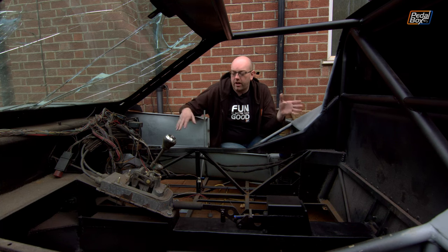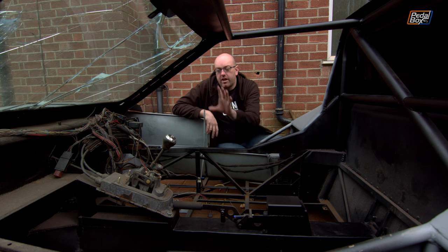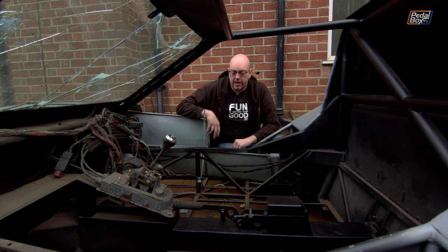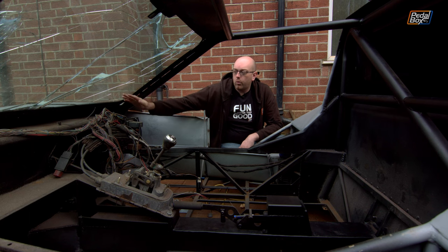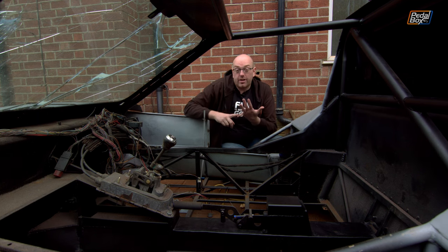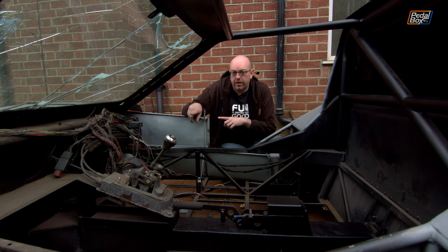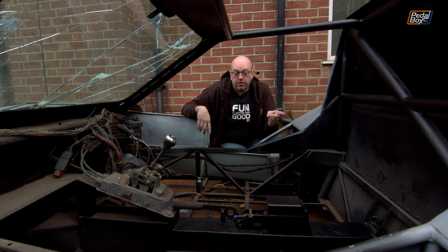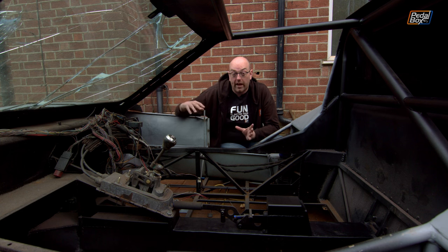For quite a long time the cockpit was the most complete-looking part of the car, because it had a lot of its services installed. The handbrake is in, the gear stick is in — although it doesn't have its gear cables yet, they only go in so far and are missing about two and a half metres of their reach. We also have the fuse box in and the wiring thinned down — a mammoth job that took the better part of a month, stripping out things like the air conditioning system and airbag system, as we have neither. The car will have a heater, but running on its own external circuit off the main battery supply.